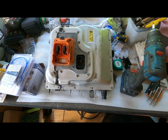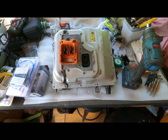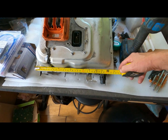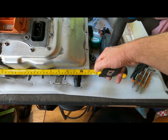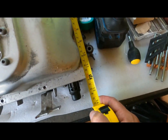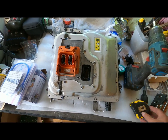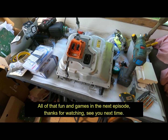There's the inverter, all kind of together temporarily. Got to strip it back down obviously to make all the bits work, but in terms of the physical size, that's all done and it will fit nicely into the Mini. For anyone out there that wants to do this: you're looking at about 333mm — just over 13 inches — and that way it's about 305mm in terms of the actual case itself. I think what I'll do now is drag the motor out of the car, get it set up down here, get the inverter bolted onto the motor, and start figuring around with it.